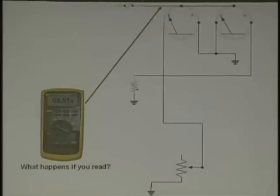Okay. Let's say you find high resistance here or the fuse is corroded. You clean it all up, you fix it, fine. Don't stop there. You needed to check those other sides, the ground side, right? And make sure the gauges were good. Everyone all right with that?